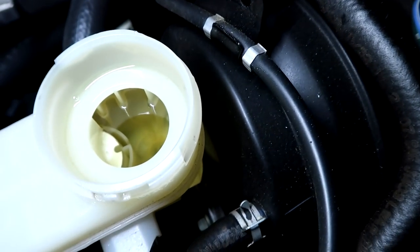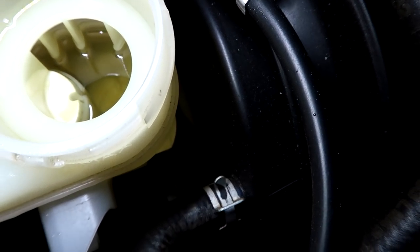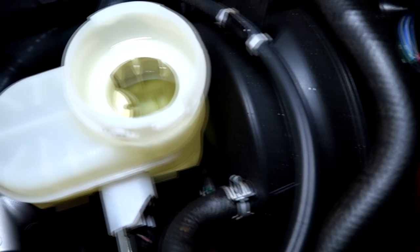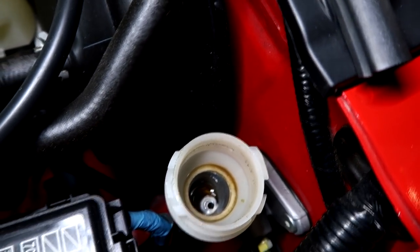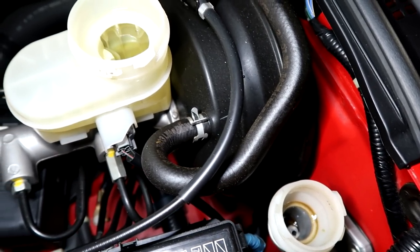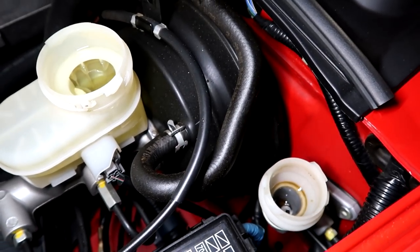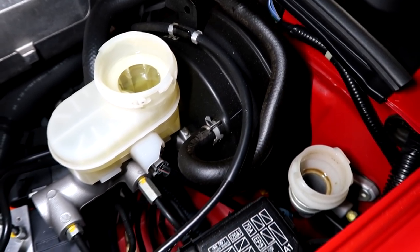It's starting to go clear — this is after running a full quart through. It's getting all that cloudiness out and junk. We're still doing it on the driver side. I typically pump most of the volume out here, then start going through the whole system after that. We've flushed that through, we have nice clear fluid. We've sucked down the clutch — you can see actually how dark that is. This is something that nobody really talks about. The fluid in here is almost like a hydraulic cable. The fluid passing through the hoses and through the master and slave has material in it, debris in it. It's amazing when you change this how much smoother the whole operation gets — it's like putting a brand new cable in it. It's so noticeable in the pedal. Actually surprising.